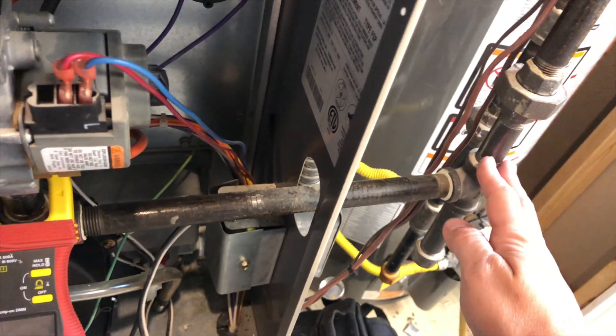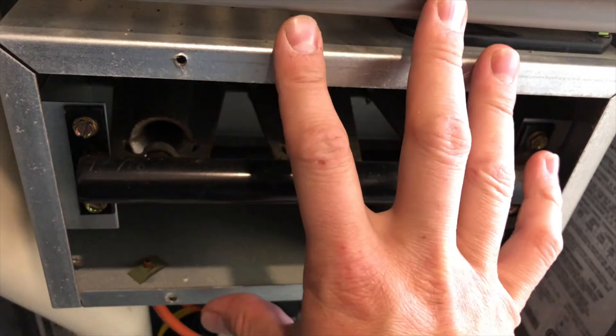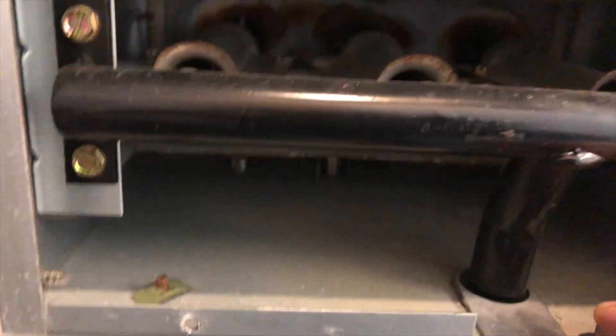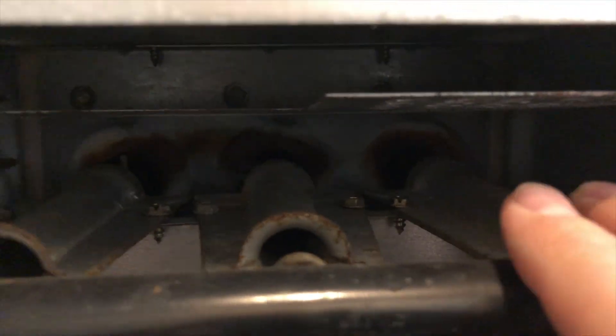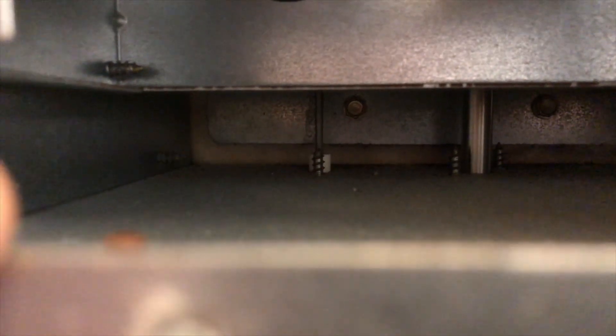You can see our gas line coming in right here, leading up to this gas valve. This gas valve opens and sends gas to these burners. Your burner box might be in a different location — mine's on the top, sometimes they're on the bottom. Inside of this box is where the ignition takes place. I've got three burners, and right in the back there are two sticks. On the left is one and on the right is another. Your igniter might look different than mine — mine has a metal shield around it. The other stick over here is your flame sensor. If your flames are lighting then turning back off, that might be your problem. If your flames aren't lighting at all, this might be your problem.